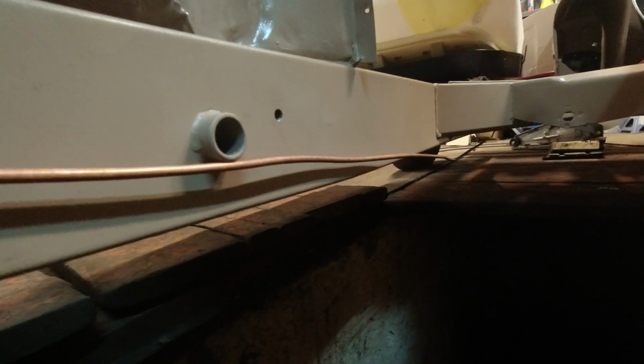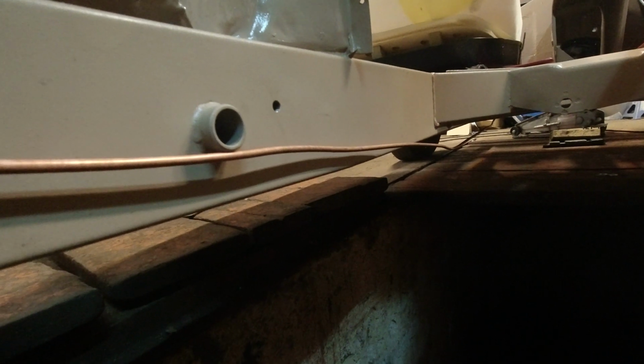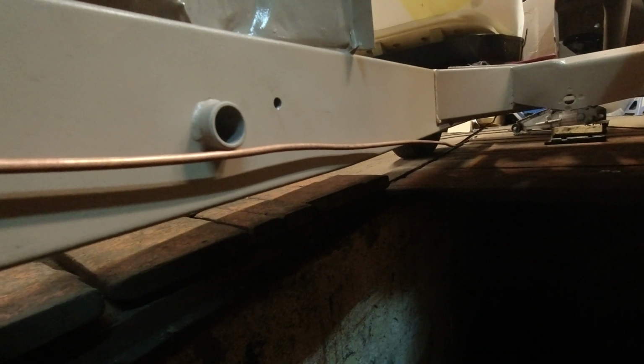See, the problem with regular copper is, I know we've talked about this before, when it wiggles, it will work harden, and when it hardens, it'll crack. So on brake lines, you don't want your brake lines cracking. So they've developed this alloy that stays flexible. It won't work harden like regular copper will. So it's safe to use on brakes.